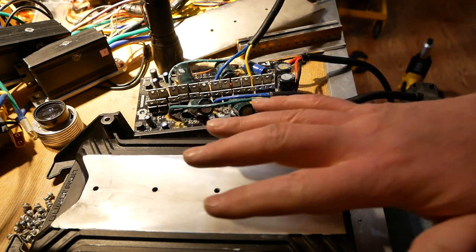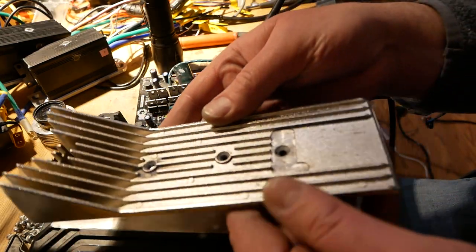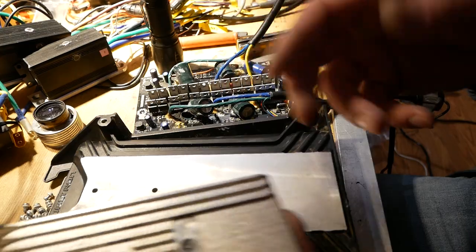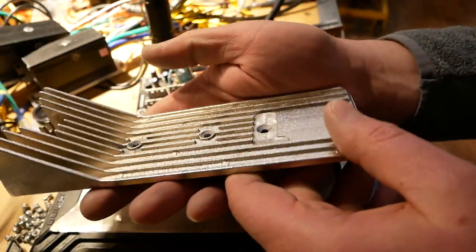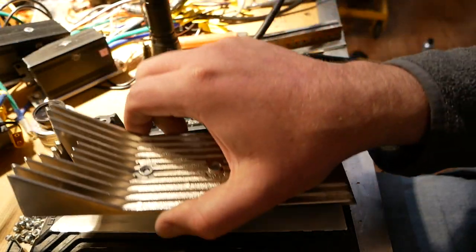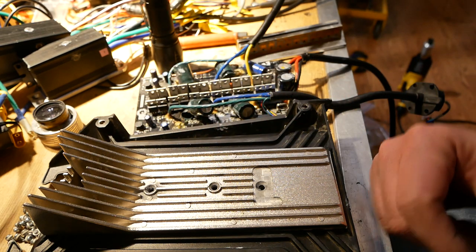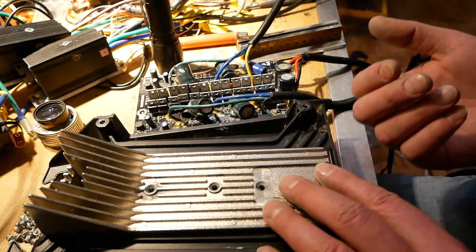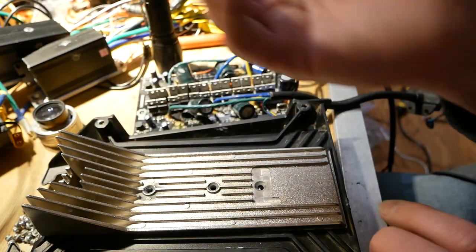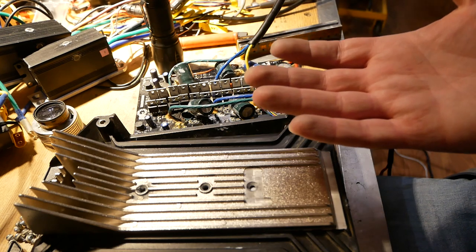Controllers were blowing up, so Dualtron said let's slap a heat sink on there. They machined it flat and came up with this thing — which isn't aluminum, it's like zinc or pot metal or something. Aluminum is shiny and this is gray; it rings wrong, everything about it says not aluminum. It did have thermal paste underneath it and screwed down into the heat spreader. But right there sitting snug up against it is the plastic wheel well — so literally no airflow happens here at all because it's completely covered up by a plastic wheel well. Dualtron, what the hell were you thinking?